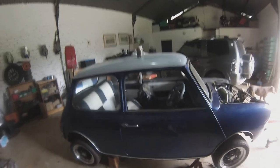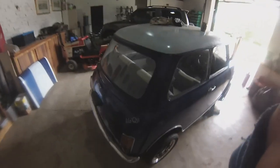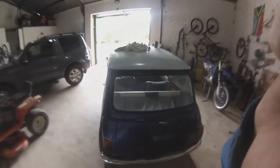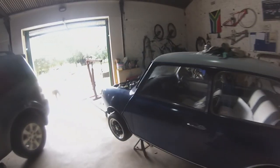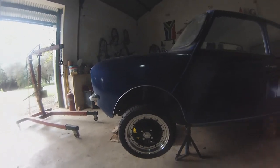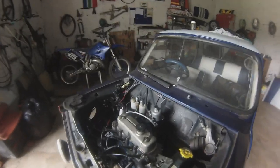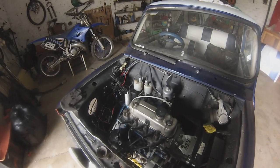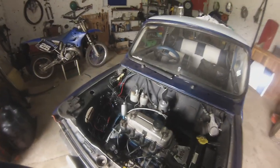So this is the subject car we're going to be pulling the engine from today. This is my 1975 Clubman Mini, built in South Africa at the Cape Town plant. We've got some JDM-inspired rims, 13 inches, A539s as you can see. And then here we come to the block — most important thing of the car. It's a 1275 Big Bore from Cape Town as well, apparently with a Cooper S head, so it's really got good compression. We were talking 9.5 plus bar on each cylinder. So that wasn't bad at all.